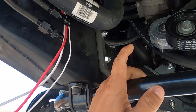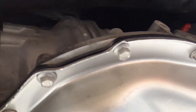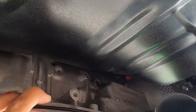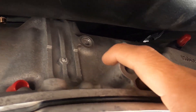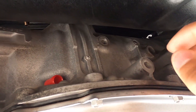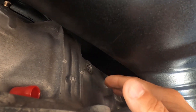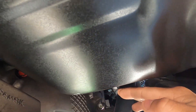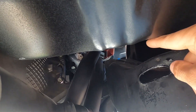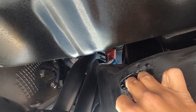I'll probably need to run to the store to find fittings and more 3/8 line because we might be short. If I can't find banjo fittings that work, Plan B is to go soft line. An AN 90-degree fitting will fit here with soft line, so if worst comes to worst we go soft line through here, back out to a junction point, and then do the hard line through the frame. That's kind of Plan B — we'll see what we can find at the store.